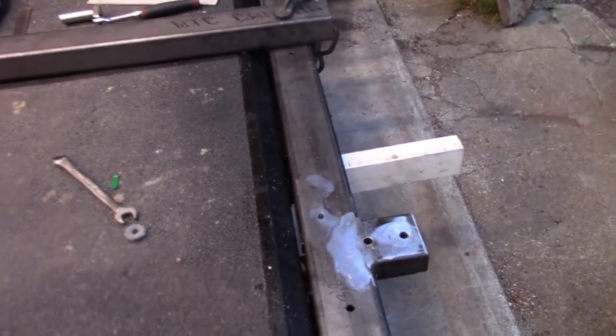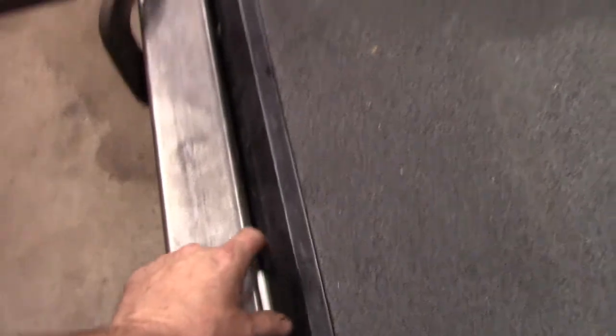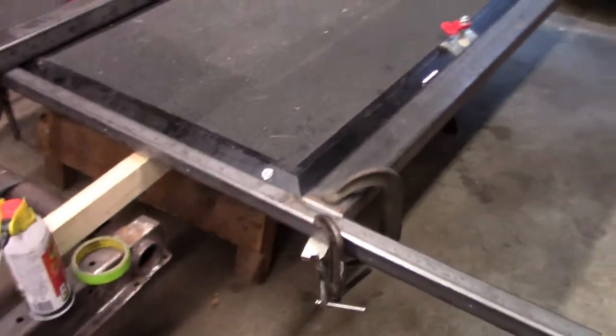welded in bungs. So the hinge is bolted to the cross member. Again, I used the door as a fixture. I've got 1/4-inch shims all the way around. It's spaced up the proper amount for the flange to sit against the frame and the gasketing.